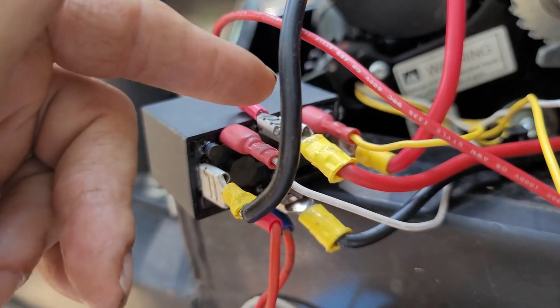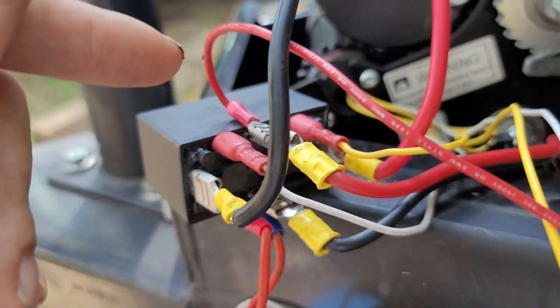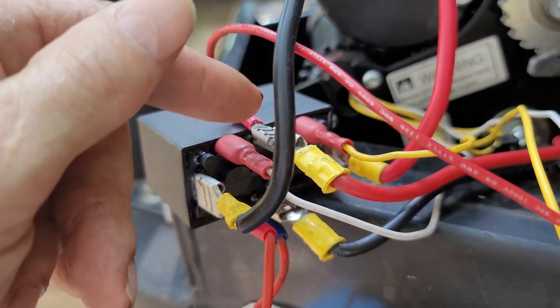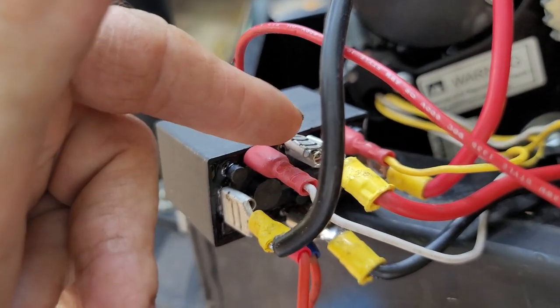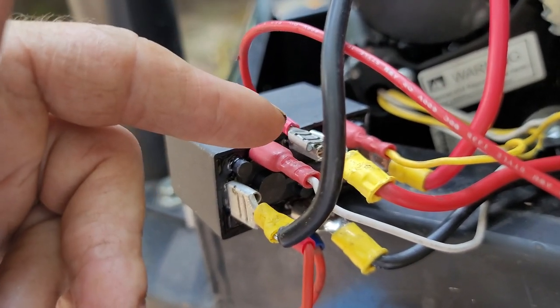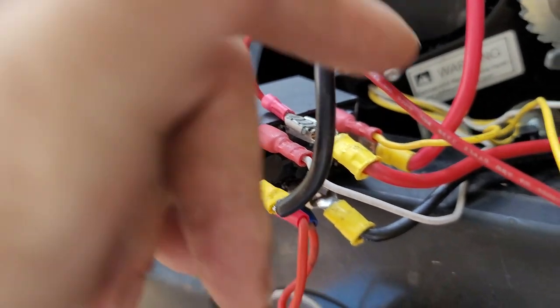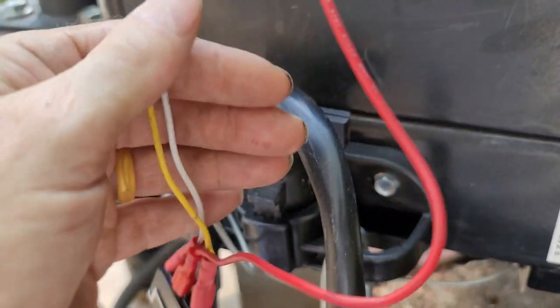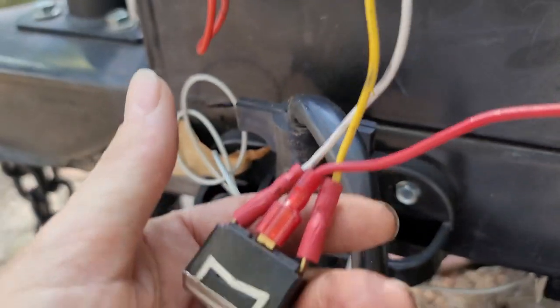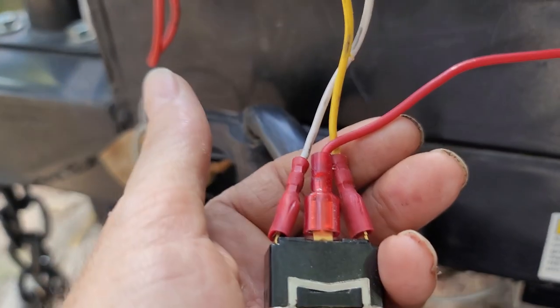This big red wire is hot from the battery; it goes into the positive — it's labeled on the solenoid. But you need a hot wire going to your switch, so I tapped into that. I'm going to redo this; this is just because I still have to run to the store but I wanted to test it and make sure it worked. So I spliced in right there, and this goes to my switch — that's my hot switch. So you add a hot switch to this.